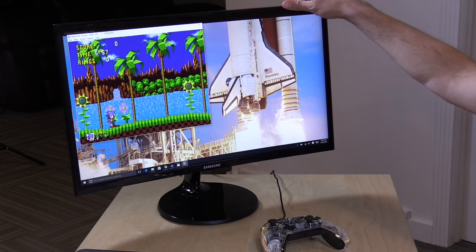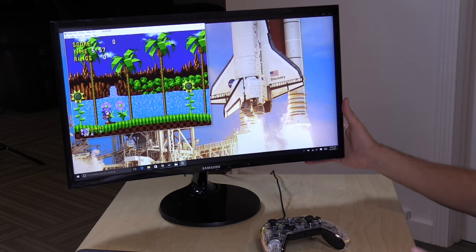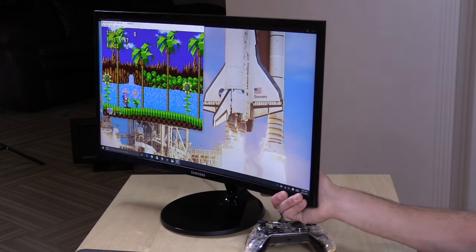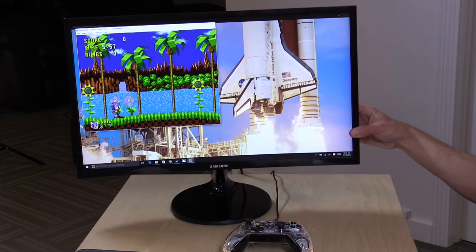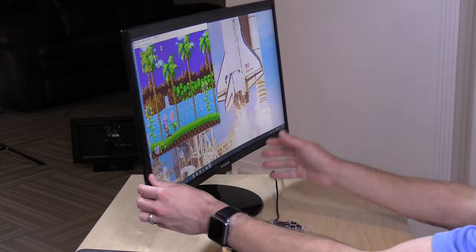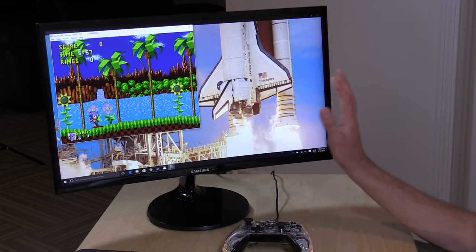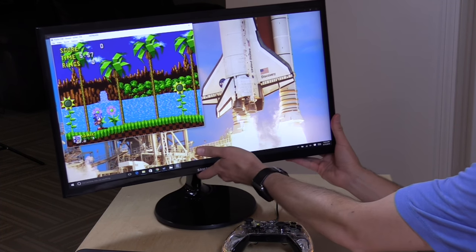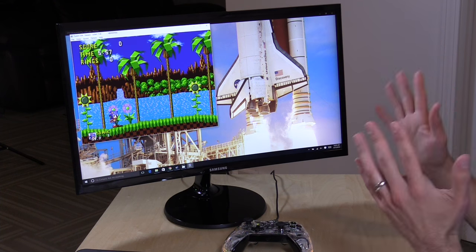What's interesting about this display is that it's running with what they call a VA panel. That means it looks great when you've got it in its sweet spot, but when you go off center, you will very quickly lose contrast. See what happens here as we move the display around — the image gets very washed out because it doesn't have very good viewing angles from the side. What you get when looking at it dead center is very good contrast ratios, nice deep blacks, and very little backlight bleed. But you lose a lot when you're not looking directly at it. I called a similar Samsung TV a one-couch television; I call this a one-desk-chair monitor.